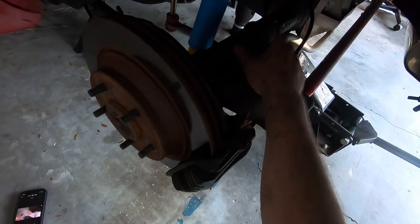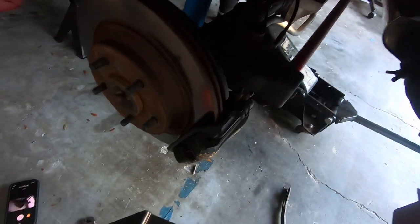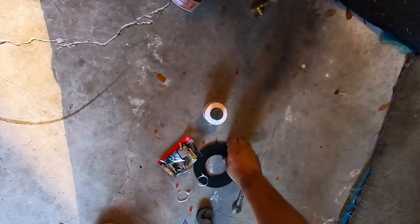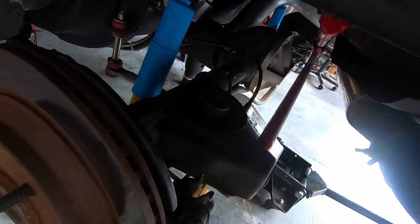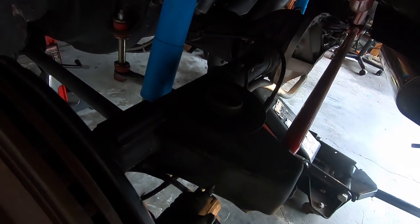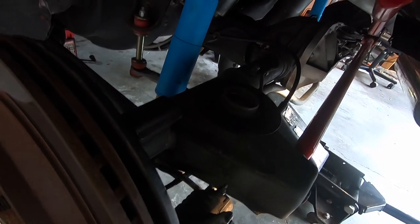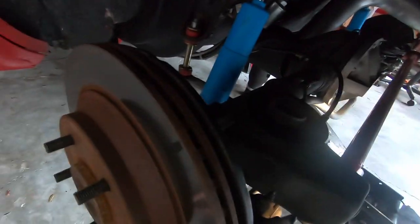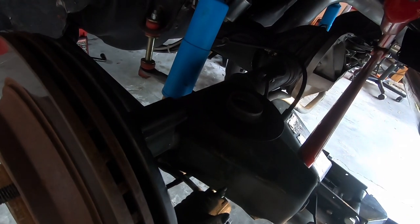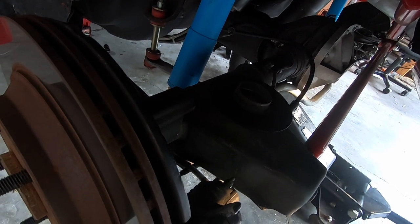It's going to ride right on the spring perch, and I need to get a plate. It's going to be this right here, away from the bottom of the car, and just get it up in the interior as possible. So my plan is to run the line, hopefully near the shock stud there, somewhere around the bracket, and then put a grommet in it, and we'll go from there. So yeah, you can see here, and that's where the air spring's going to ride on right there.